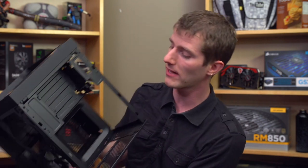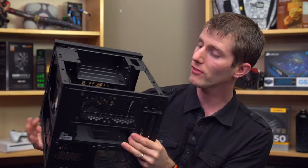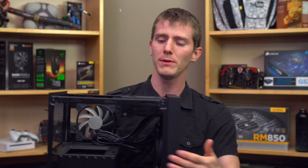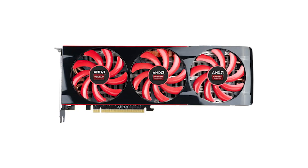Let's pop off the top — that gives us access to the inside. There's that 5.25-inch bay and the clearance for the included 120mm fan as well as a radiator. Even with ASUS's mini ITX boards that have the riser PCB portion for the power delivery, you're still going to have enough clearance, but it's really, really tight. GPU length-wise, you can install pretty much whatever GPU you want with the exception of some really long ones like the 7990 — that one does not fit.